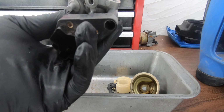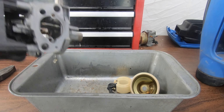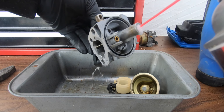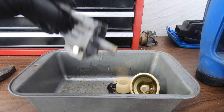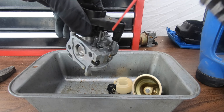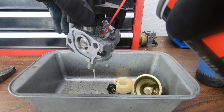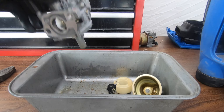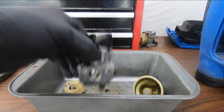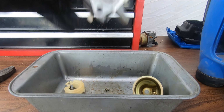Do the other one — I see a lot of dirty stuff there. There you go, that cleared it up. Now we're spraying these passages up here — these are the passages for the low speed, so you want to clean those up. You don't have to waste the whole can of brake cleaner like I used to. This guy is really not bad; it took no time.